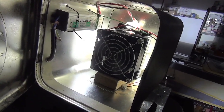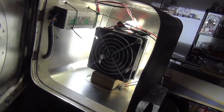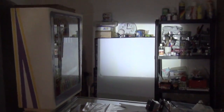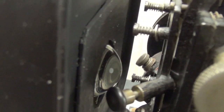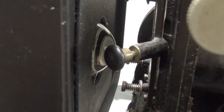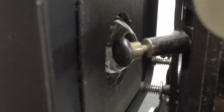The unit in there is a 50-watt, and normally they don't have any mains ripple evident, but I won't know until I've got the machine running with the shutter going. So that will be at some stage soon, and then we'll make sure that we've got no flicker from the mains. I could try swapping that condenser with one for a less pronounced curve, which might get rid of the slight drop-off on the edges of the projected frame, but it's not bad.